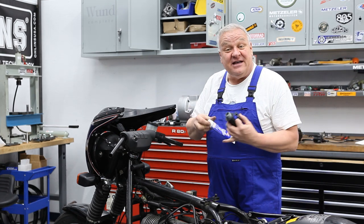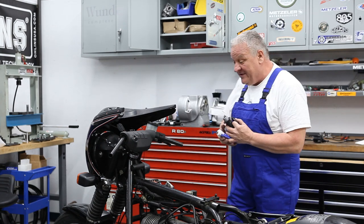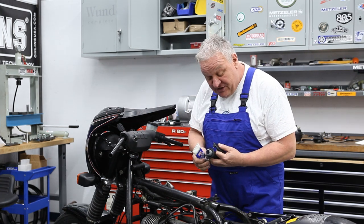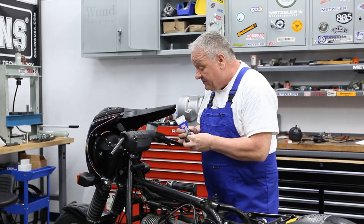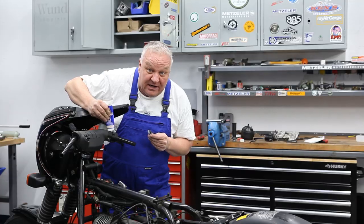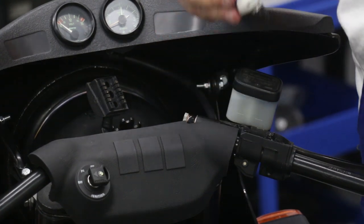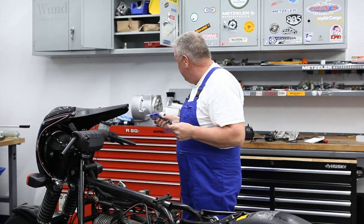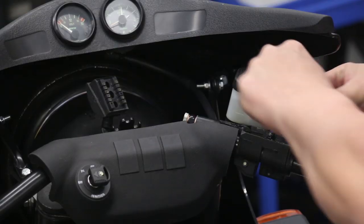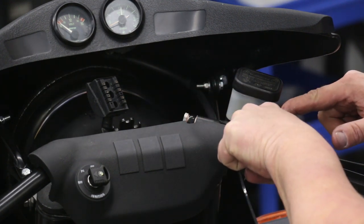Okay, and the LM47 grease, which you've seen referenced many times in these videos, is a really good choice for this particular application. So what we can do is put a nice amount inside of here, around the pivot point here, and also right in this area, a little bit where the actual chain part's gonna slide. There's plenty of room for lubricant in there, so you can hardly overdo it. And then we'll let the chain cam right in like this, so that this part just is touching.